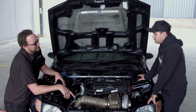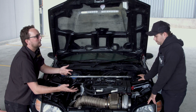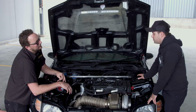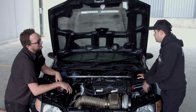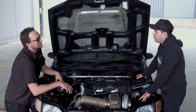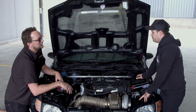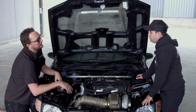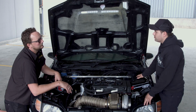Perfect. And that water pump, I suppose, if the engine gets hotter or colder, it pulses at a different rate. That's correct, yeah. So it adjusts speed via the controller inside the car. If I'm running it flat out for a while, I just turn it up a little bit to circulate a bit faster. And if I'm cruising on the street, it doesn't need to be full blast, so just turn it down.